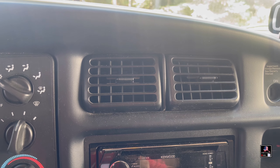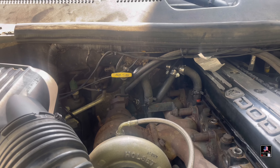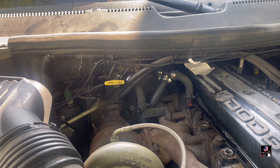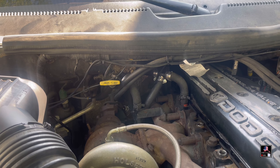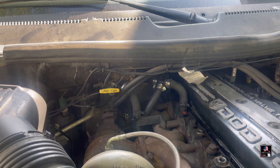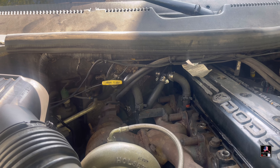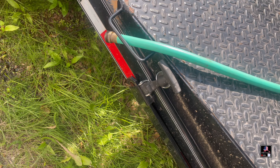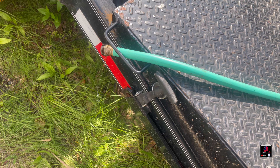I'm getting not even lukewarm out of it, whereas this gets burning hot. Once you've located the hoses you need to disconnect, disconnect them and make sure you have a way of catching the old coolant — a five-gallon bucket or some type of container so you're not dumping contaminants everywhere. Remember you are working with coolant, so safety first: make sure you don't get burned, let the truck cool, wear your safety glasses, and protect yourself.